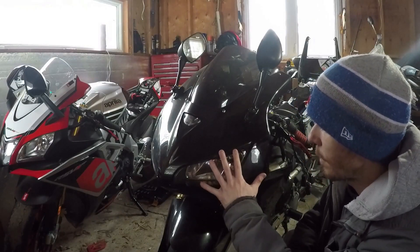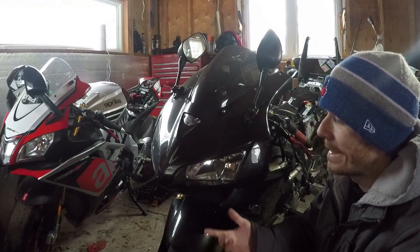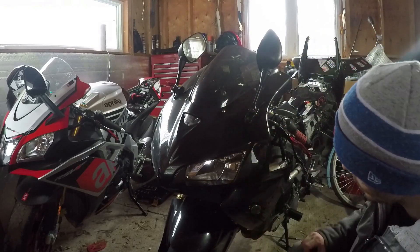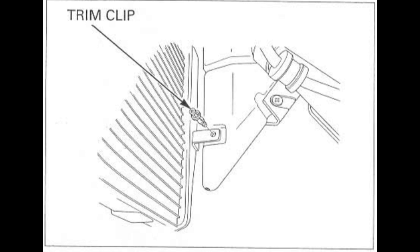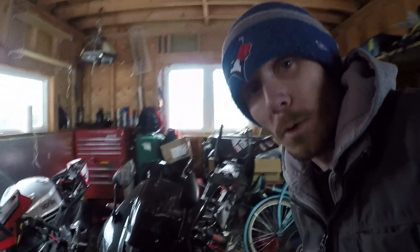So we are going to take off the front cowl. By now you already got your side fairings off and your tank fairing off, so we're going to take the front cowl — kind of a pain in the ass, but it's not a huge deal. We just got to remove the mirrors, which there are two screws holding each mirror on. And because we already got the side fairings and the tank fairing off, just got to remove this screw, this screw, that one, this one. But there are also two screws right down here holding it onto the actual radiator, so you just want to take those out. Six screws in total, so I'm going to go ahead and remove those.